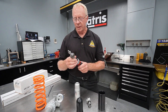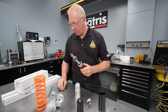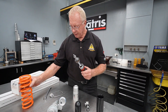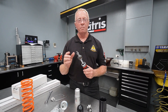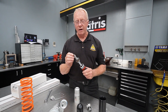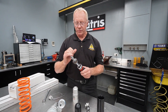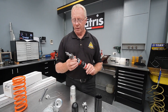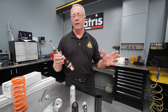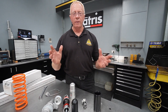What we generally find is we want a much bigger bleed in our separation valve than what we've got here, so we're really not getting the control that we want. To fix this, we're going to change the arrangement in here — we're going to increase the size of that bleed to what we've found works best, and we're going to put a little step washer in here that will allow us float, much like what we get off a fork mid valve. By putting in that float and changing the valving, we'll get a really good result, and that then allows us to configure the valving on the main piston in a very conventional manner and tune for the effect we want.